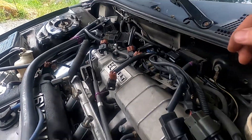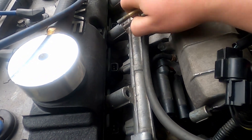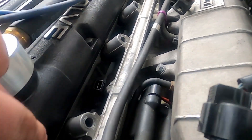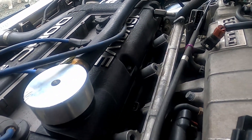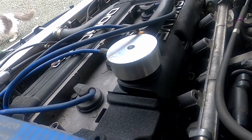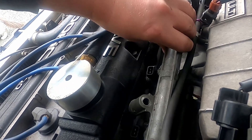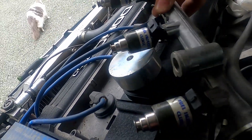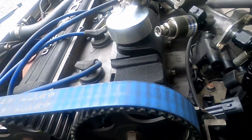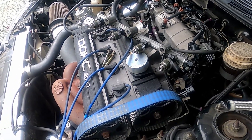Got a little bit of my wiring harness out of the way and undid my PCV. There are only three bolts holding the rail on - they're all the same size so it doesn't matter if you mix them up. There are these little spacers in here - if you've never done this before they like to fall out, and if you lose them it kind of sucks. Some people will RTV them to either the block or the bottom of the rail. One of them popped out. These are the 650s, and all of the injector seals stayed in the manifold. Just pulled my fuel rail.